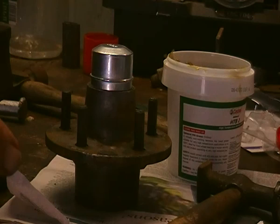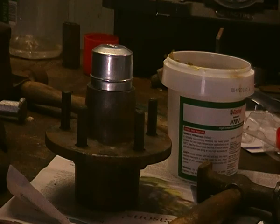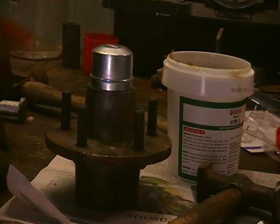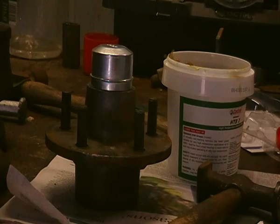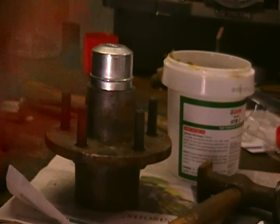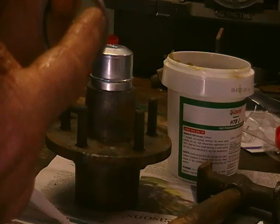You can check it with the torque wrench if you want to, but if you do it that way you'll find in most cases it will run like that forever in a day. If you overload your bearings you're going to chop them out in no time at all. Underload them and you've got a problem because you'll destroy your hub. It's very important that you pre-tension and put load on these bearings because they're a taper roller — they are meant to roll with preload. Ball bearings are not. The ball bearing sits freely to rotate within the housing. These are meant to have pressure against the bearing face to transfer the load. Very important. That size of bearing has been used on a car that weighs 2,600 weight or say 3,000 pounds for a long while — shows you how tough they are. Okay, that's enough for now. Thanks for listening.